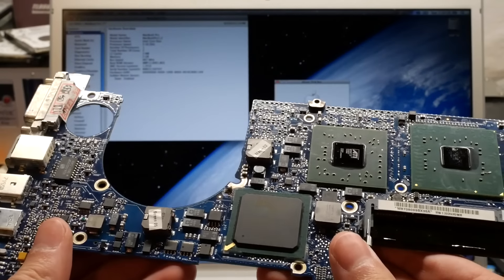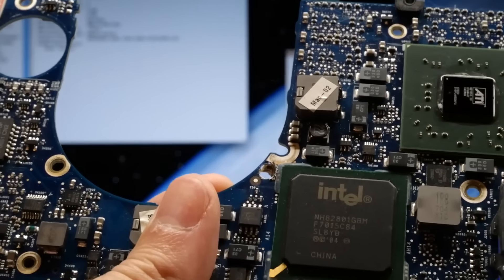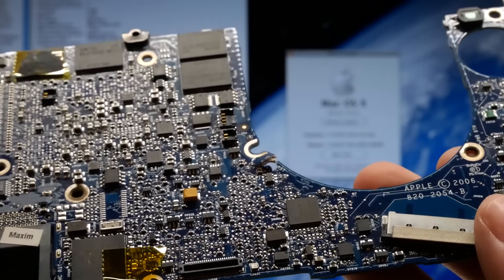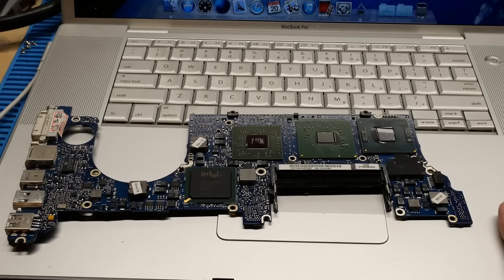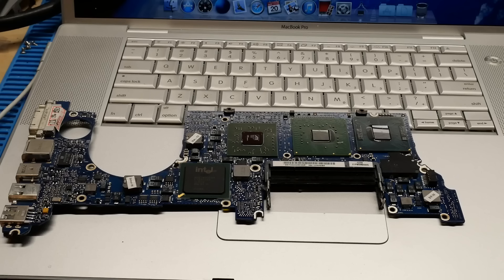The reason it's dead is, if you take a look in an area on this board, you can see that it's got a drill hole in it. I don't know why someone would drill this board in this particular spot, but this was sent in to me with this machine by the person who owns it to pull the CPU off of. The first thing I want to do is get this machine — the 17-inch Core Duo MacBook Pro — fully taken apart and get its logic board in the dehydrator to remove any potential moisture from it. These boards are very prone to retaining moisture inside them between their layers, and any heating or soldering on them usually will cause them to popcorn if not properly prepared ahead of time.